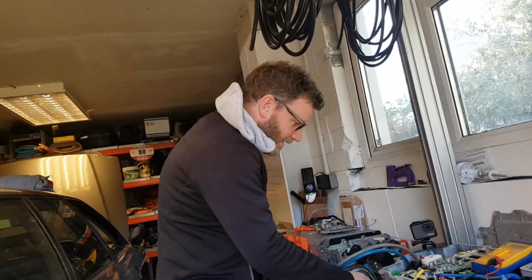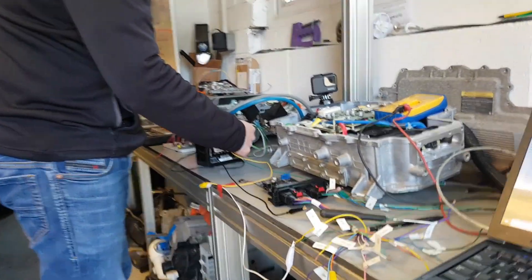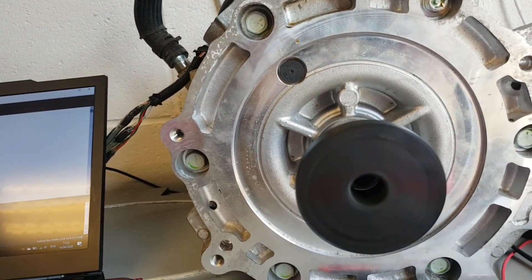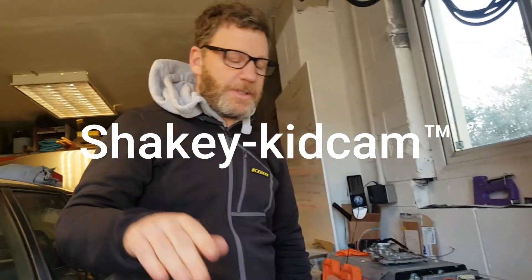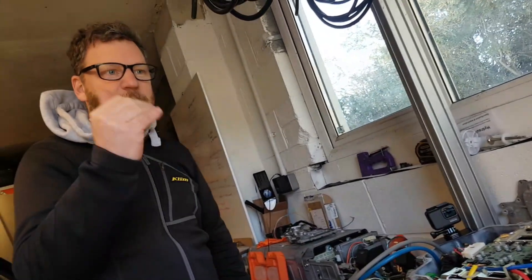Everything's set up — power in here, you can move back a bit. Energizing the boards, so twelve volts in, see the board here lighting up. Twelve volts, pre-charge, pre-charge, pedal — ready. Wow! And then we can kill it. That didn't happen before. I gave it its full juice. What happened before was I had it on pre-charge and it just tripped. When I gave it the full 220 volts it actually stays up at that voltage, so it stays there, gets its torque commands going in. Thank you for taking this video.